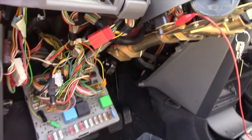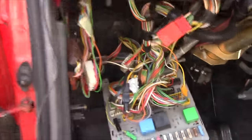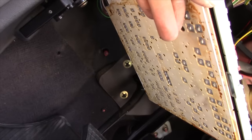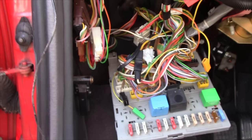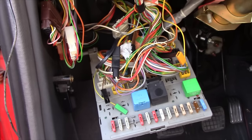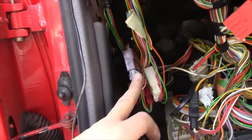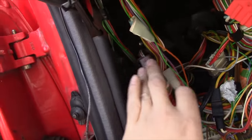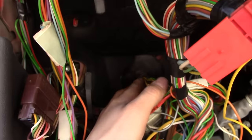I took the lower part of the dash out and started tracing the wire which was shorting out to ground. I also took the undercover of this rather special fuse box out in order to check if there was a bad solder joint or some weird short, which indeed there was not. After some more fiddling, I found out that the cable didn't even run to this box, so taking it apart wasn't entirely necessary. The cable did run to this connector, and disconnecting it made the short go away. So, the short has to be downstream on this connector, which runs through into the engine compartment.